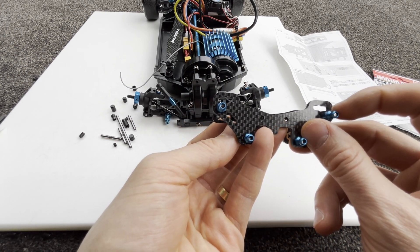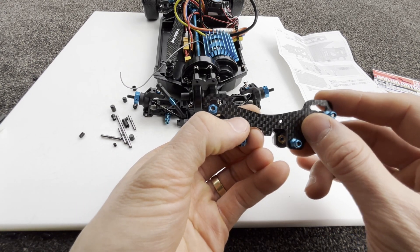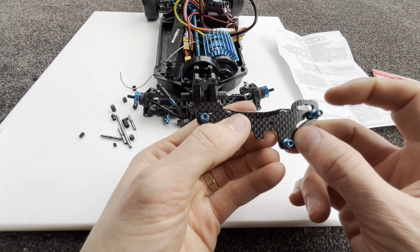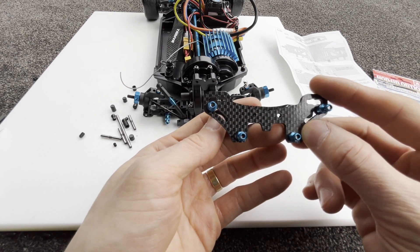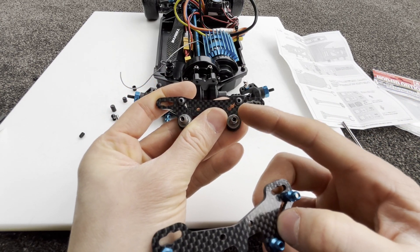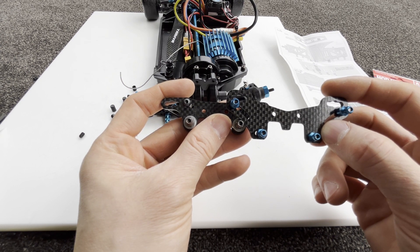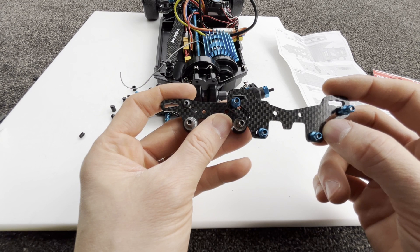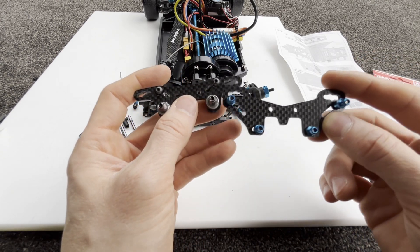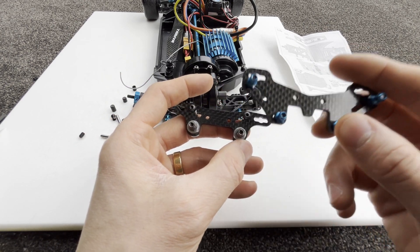The damper position is all the way out here — that's a massive difference. We can have more of an upright damper mount position, which is going to be interesting to test out. On top of that, the camber joint position is also quite a bit lower — about 8mm lower — which is considerable and will change the roll center drastically. That's really good.